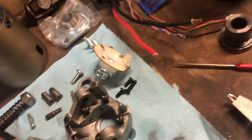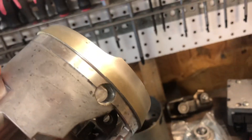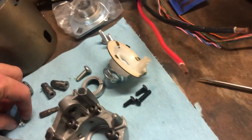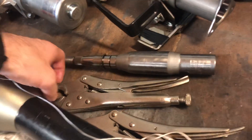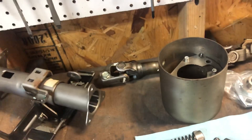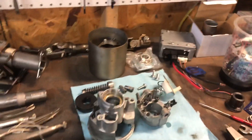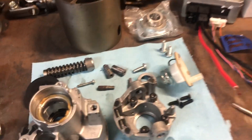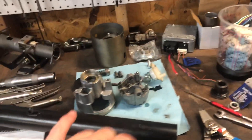This is the big tilt pivot piece — it hooks on to these little levers and tabs, which is what pivots the column. Once the spring is free, you have two pivot pins on the sides that pass through and into these holes. Thread in an 8-32 screw, clamp on a pair of vice grips, and give it a smack with a rubber mallet — that's the easiest way without a mini slide hammer. They're not super press-fit so they come out fairly easily.